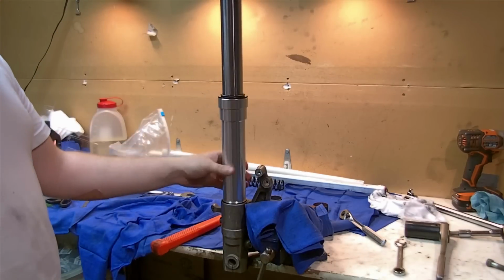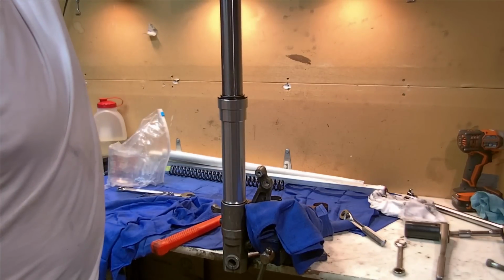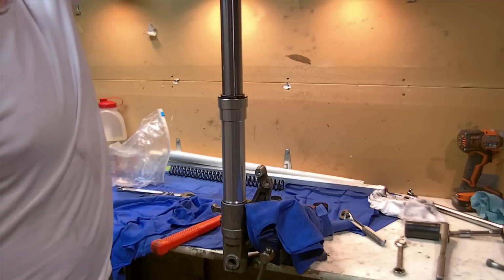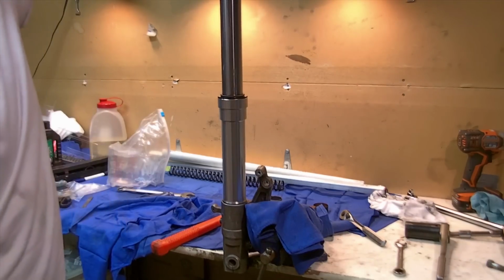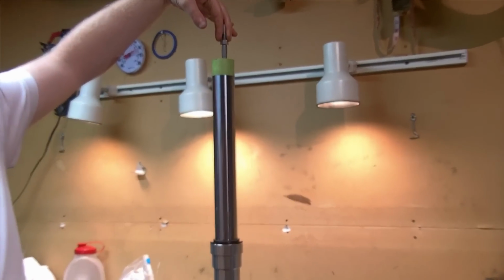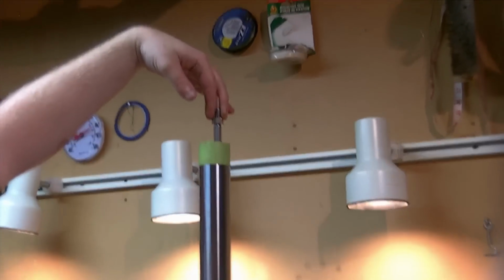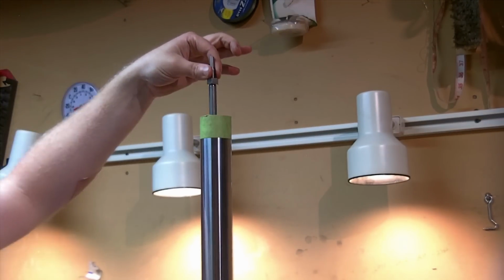Be more square there. We need to pull the rod up, and there is a special tool that threads to the end of the damper rod, because this is going to fall into the tube now. And we need to be able to stroke this when we bleed it, this rod here. And once that falls in the oil, that's going to be tricky to come by.